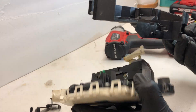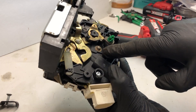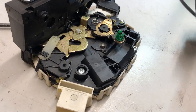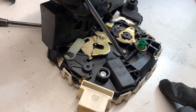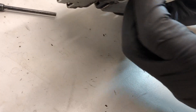With that out of the way, this plastic cover lifts off. The trickiest one is this pin — it comes through to this push clip. There's no clean way I know of getting that out apart from messing around and digging it out. I'm not going to reuse this because I won't be able to get it off in a reusable form, so I'll be replacing it. I actually used my soldering iron to melt a little bit of plastic, just enough so I could get something under there to lever that spring off. Bonus points if you get that off in one piece — then that pin drops out.